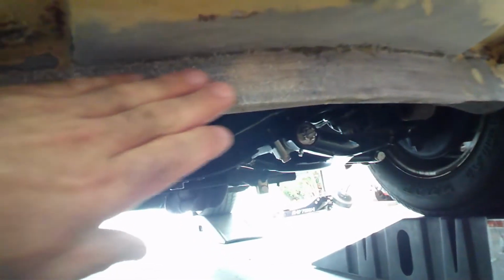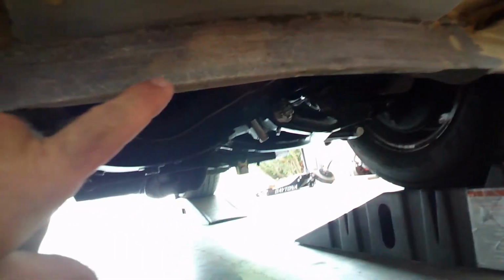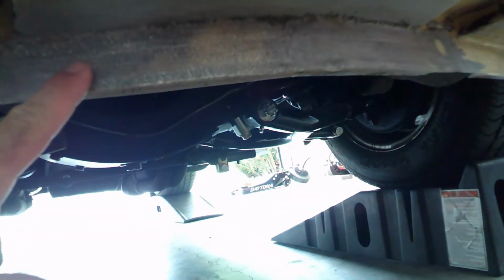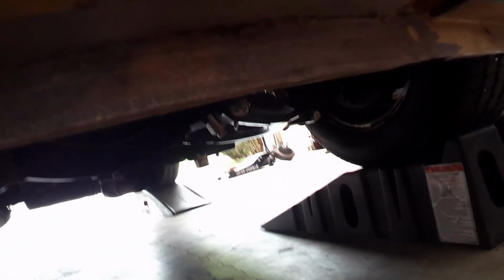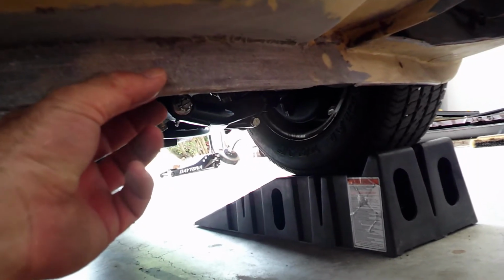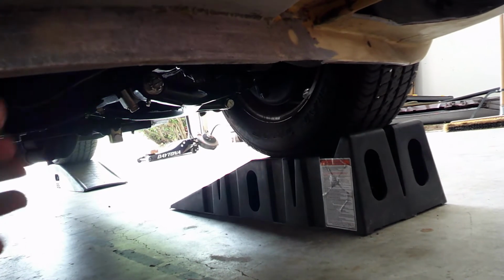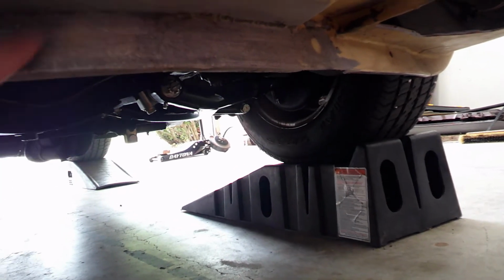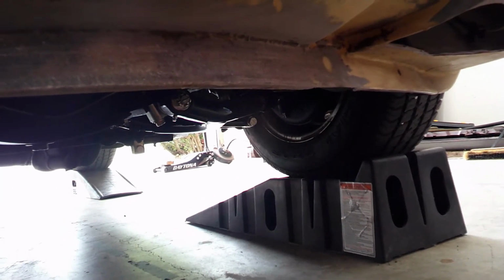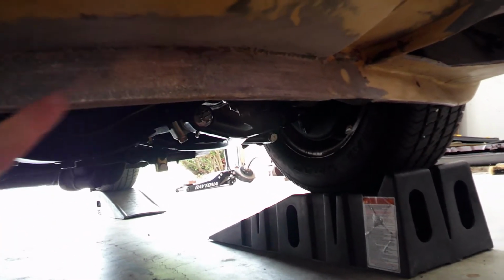So some of the repairs I've done is, if you look here at the lower splitter, this thing was completely mangled. Apparently from about here over, it had hit something and had been completely cracked off, and somebody went in and put about a 1/4 inch thick Bondo in there. And the Bondo wasn't really cured. It was pretty soft. You can move it around, but it also had apparently just entrapped water over time, and it had a bunch of mildew and stuff built up into it. So it turned out to be a bigger job than I had expected.